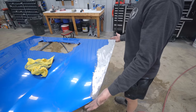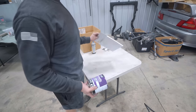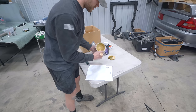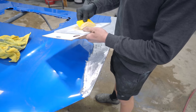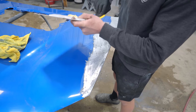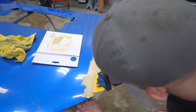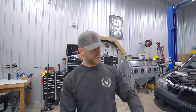The whole entire affected area is ground down to bare metal. Filler of choice today — we're going to be starting off with the U-Pol fantastic body filler. We'll start with this, sand, and we'll probably finish with a little bit of U-Pol glaze. Always got to mix your fillers up good because there's a bunch of oil on the top — that all needs to be mixed in. Didn't put too much hardener in there as we have quite a bit to spread today. Applying filler is actually more difficult than it looks, and I tend to not be very good at it. But that's not bad. Let's let that harden up. As that fully cures, let's start messing around with the trunk.